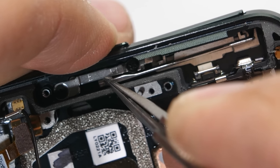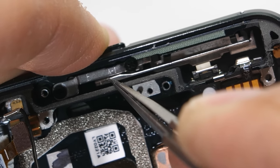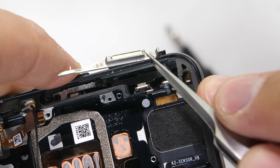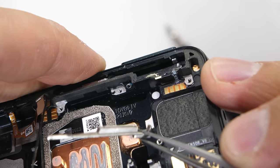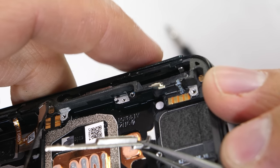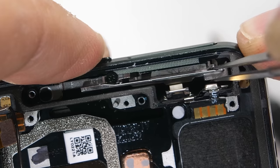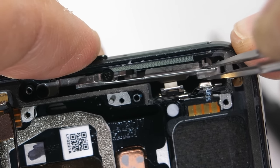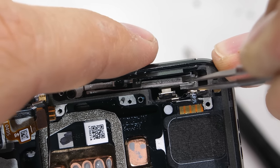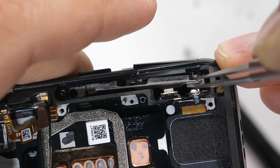When the slider is shifted down away from the button, the magnetic poles are positioned in a way that they repel each other and the button pushes up. The slider then sits under a lip from the button, which helps keep it up in the raised position. Both the button and slider piece get pressed into the third piece, which contacts the electronic part of the button setup that relays the press to the motherboard. It's a pretty smart design — probably quite a bit more efficient than last year's model with dual stepper motors inside, definitely easier to build with far fewer parts, and it doesn't use any power. I'm impressed.